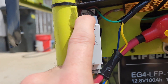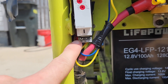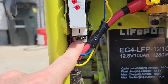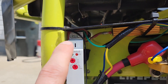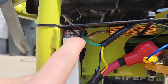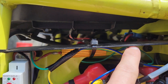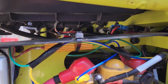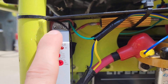Terminal 15 is also jumpered to the top of the relay. Technically, 15 doesn't power the relay — 15 provides power to 16 and 18, depending on which position the relay is in. I have a jumper from 15 going up to A1 positive, which is the positive for the relay. I have A2 negative — green wire — going to the battery main negative terminal, which provides the negative.